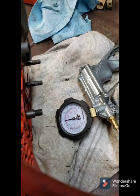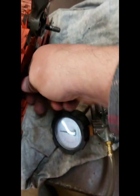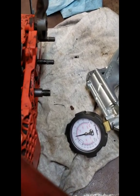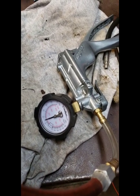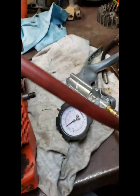Exercise the crank — turn it back and forth. I'm gonna have to get the PTO side here. Anyway, I can barely turn it. It's down right now — it's probably bled off maybe a pound, and some of that could be due to where the piston was compared to where it is now with the pulse signal.